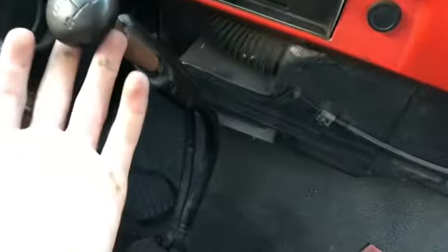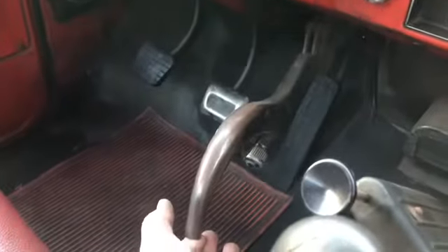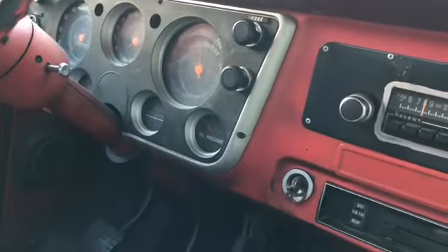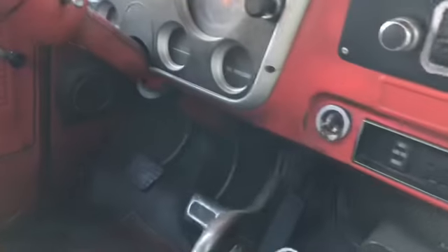Most of the time we just have the two-speed out on trucks like this because it goes a lot faster and the truck has the power. Basically if you're going uphill you push it in and you've got more gear. The only thing you can drive this truck with is the emergency brake — the brakes do not work at all. Last time we had this running over the summer the carb was a little sticky, but after cleaning the points a bit it fired right up, idled, and just purred along — and the gas in the tank is I swear 30 years old or more.